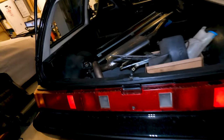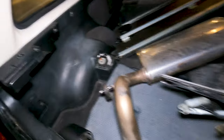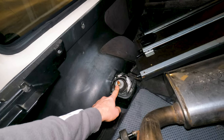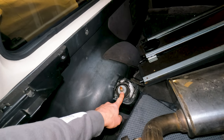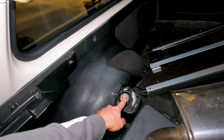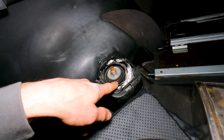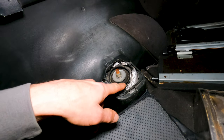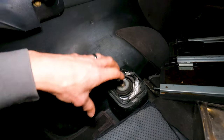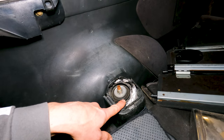As we move to the back — you'll have to forgive me, there are a lot of spare parts back here as we're doing many projects with this car. I wanted to highlight the rear mount at the top. This strut shaft here is the only thing mounting the rear suspension to the chassis at the top — this is the top damper mount. You've got the upper mount here in a rubber bushing, which is conformed into the upper mount built into the chassis. So there is no separate upper mount on top of the shock assembly in the back — it's all basically built into the chassis.